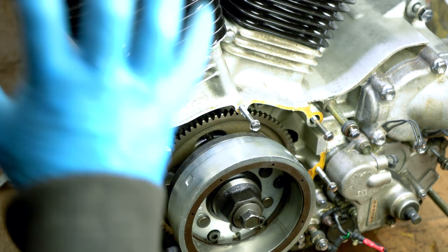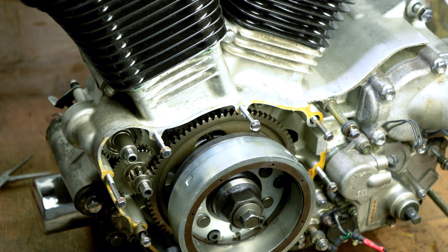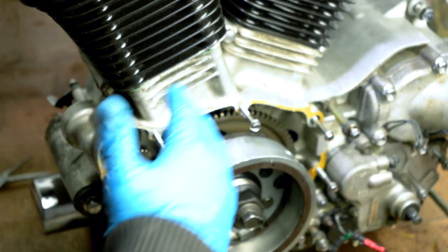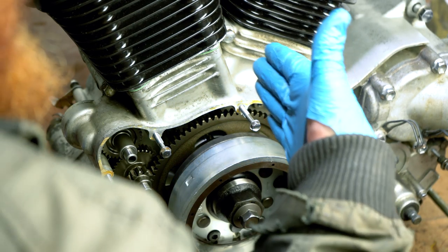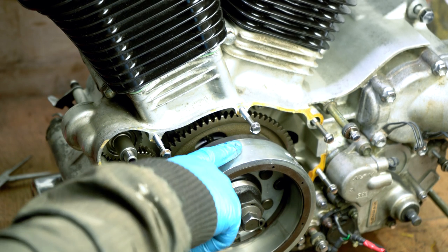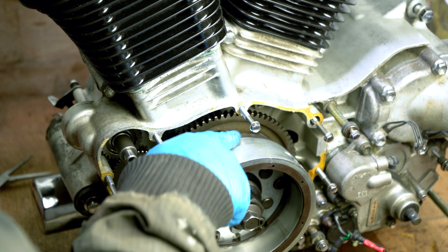The first thing we need to do with this motor is find the RT point. If you look on the inside of the stator cover, on this inner rim, you will see — you might need to rotate it ever so slightly — that there is an RT stamped on that ring. What we need to do is bring it straight up so that it's dead center with this top lug here. There's a line in between the R and the T — we want that dead center. Before we do anything at the top of the engine — before we start messing with the chains, the sprockets, the cams — we need to make sure that is in the center. If you've already started putting your cams and sprockets and chains together on top, you need to take everything off and make sure that this is in the center.